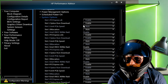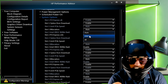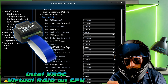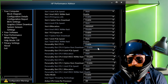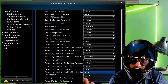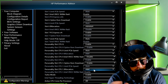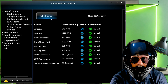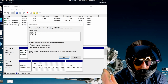Take note of this menu — you can set the speed of each PCIe slot, activate bifurcation (splitting of the lane), and enable Intel VROC, which is Virtual RAID on CPU, though you need a special adapter for that. At the bottom are the personality slots — which is what we need. It's already pre-configured for x4/x4 connectivity, splitting the PCIe slot into two clusters of x4 lanes for each NVMe. We can also check out system temperatures here — running a little hot, but we'll solve that later.